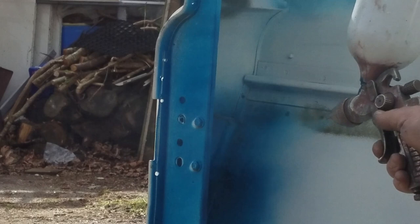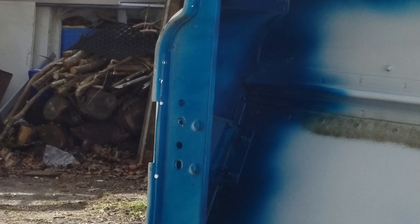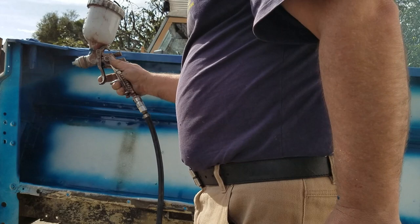I'll put two coats into these areas and then start on the flat panels. As I do the second coat on the flat panels, that will mean I'm adding a third coat into these awkward areas, and I've got four coats in all of the difficult areas. It's also where seat belt buckles are going to be flicking around and risking chipping the paint, so having extra paint on there just ensures it's going to look better for longer.